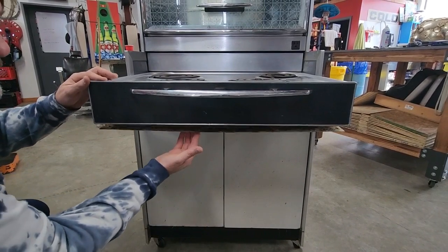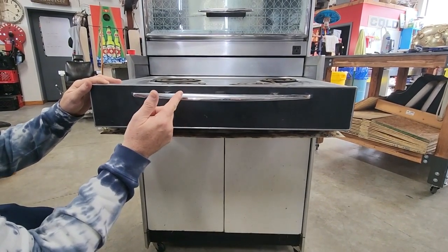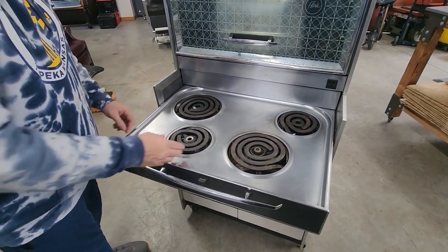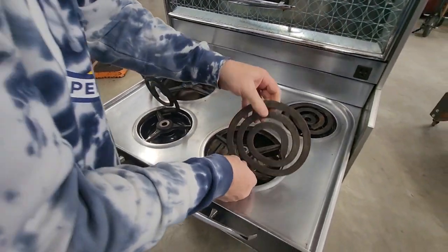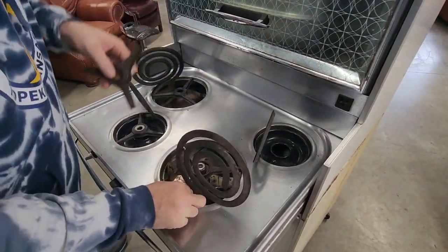As you can see, we've removed the screws and our drip pan has dropped down. This would be a good time to come up here and talk a little bit about the burner drawer. These burners rotate up for cleaning, so we're going to go ahead and rotate all these burners up, just like this, taking the burner supports out.